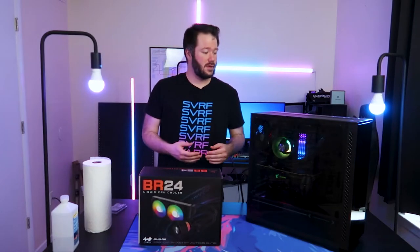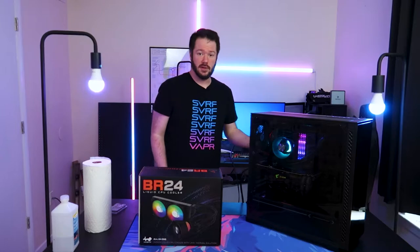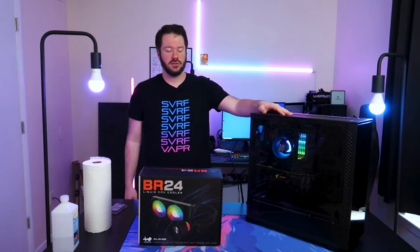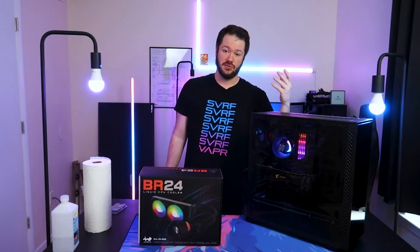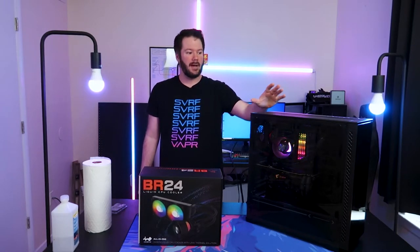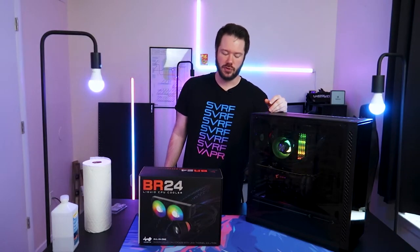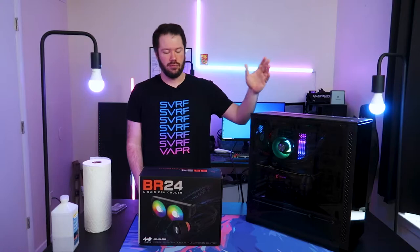The test just concluded, and I will say I'm a little impressed with the results. So let's run them down real quick. On the Deepcool Castle 360X we had in here first, getting VRM MOS temps as far as HWiNFO64 goes, it recorded a maximum of around 44C after about 30 minutes of Cinebench R23. So that's still well within range.